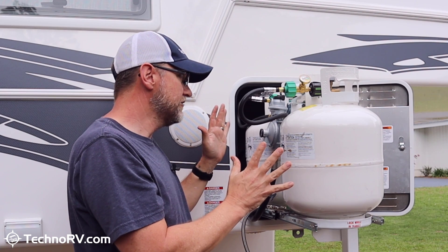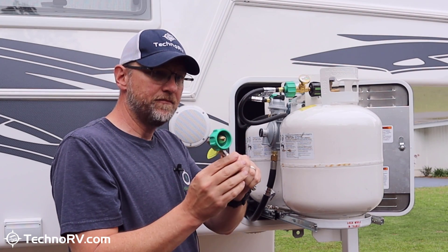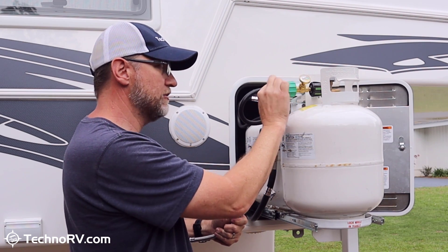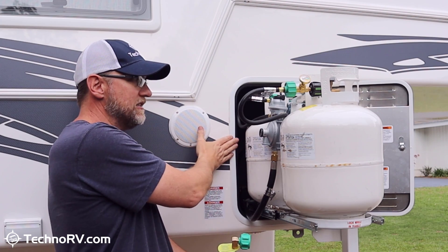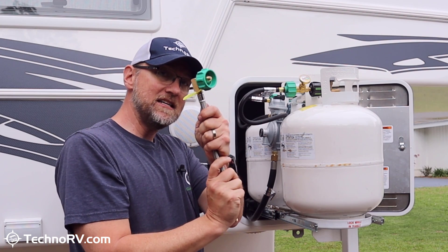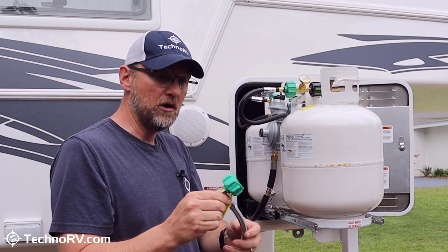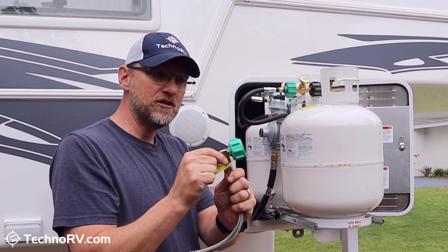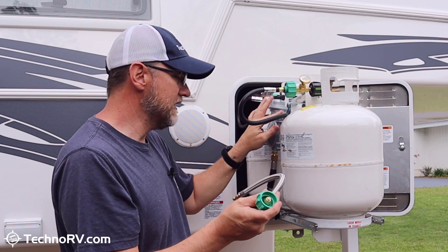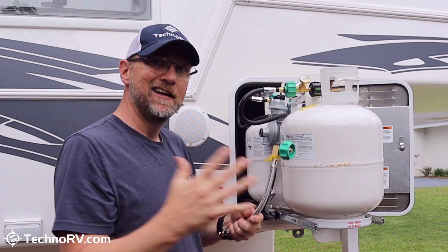I'm also going to be replacing these hoses with this gas gear hose. It's got a 90-degree bend because once I install the gas stop, you can see how much further it comes out and I've got a really tight space to push this back in. You may have an RV with a case that goes on yours. These 90-degree gas gears come in stainless braided, so it's a higher quality, and it has a nice thick brass 90-degree turn. I'll disconnect this from the regulator, screw the gas gear into the regulator, screw the gas gear onto the gas stop, and then I'm done.